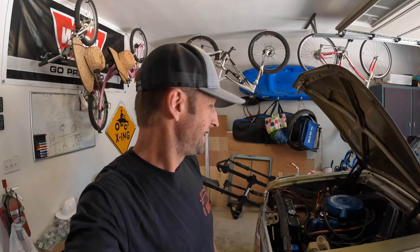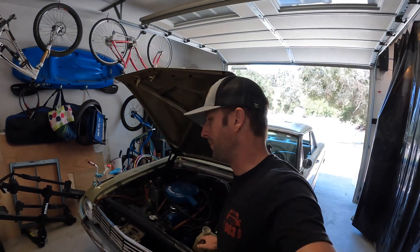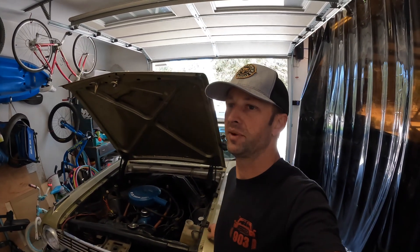So we're going to use that as a good excuse to upgrade the electrical system. We're going to pull out the antiquated generator and the voltage regulator and convert this over to a one-wire Chevy Alternator. Even when this system was working, at best it would make like 13.4 volts, and the generator is probably good for like 35 amps or so. I want to put a better stereo in the car, put an electric cooling fan on the radiator, and get the headlights brighter — so we're switching over to an alternator. It should be more reliable and more consistent.